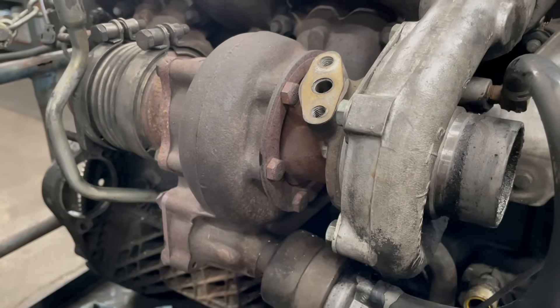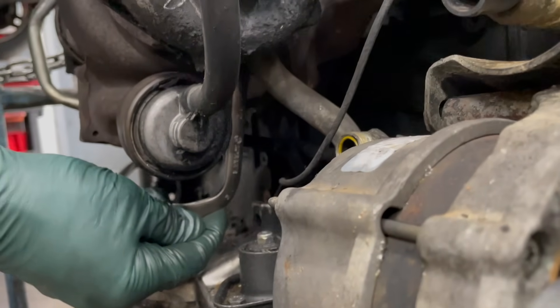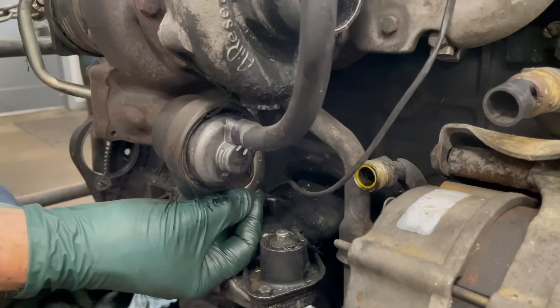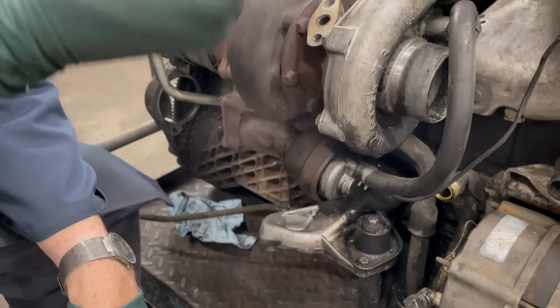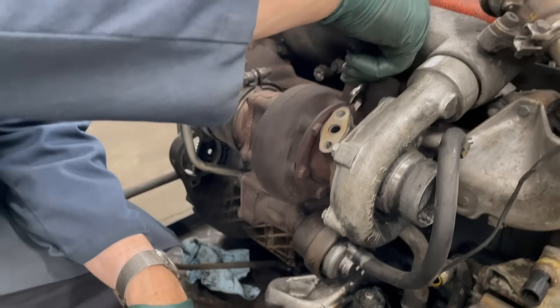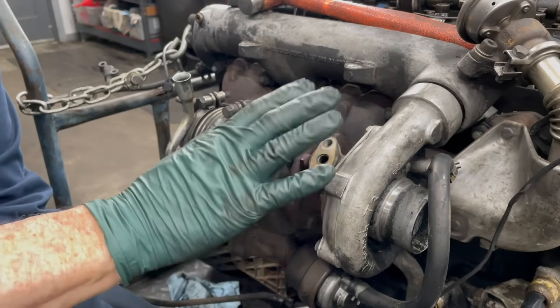To get to that bottom bolt there is not enough room for a box wrench, so you're going to have to use an open end. You can get on it from underneath, and you may even need to use a block of wood and hammer on it to get it loosened. Once it's loose, that's the purpose of the short wrenches I include — they're not for breaking the nuts loose, they're just to spin these off quickly. You can even use the 13mm since it's slightly loose and you're not worried about that once the bolts are already loose. These six bolts are the biggest challenge of getting this turbo section out so you can rebuild or replace it.